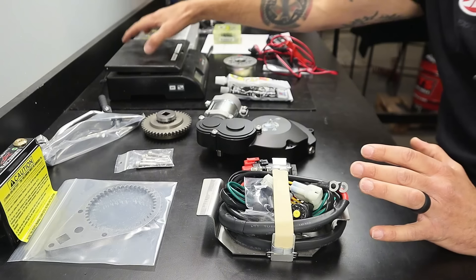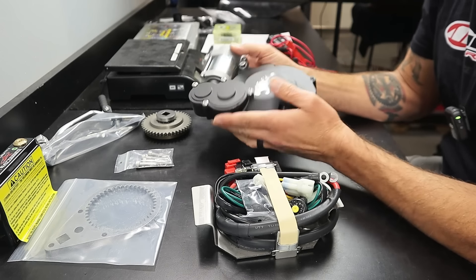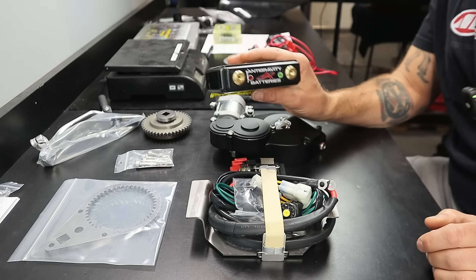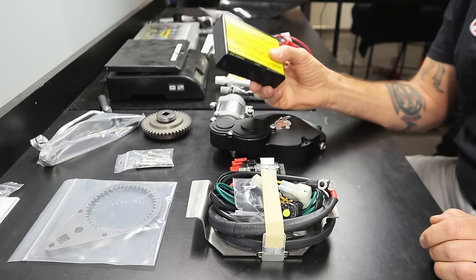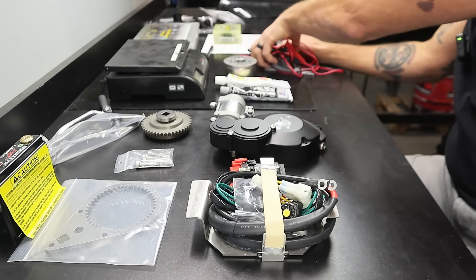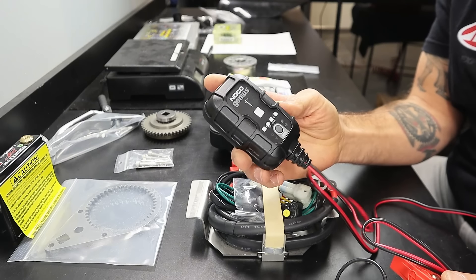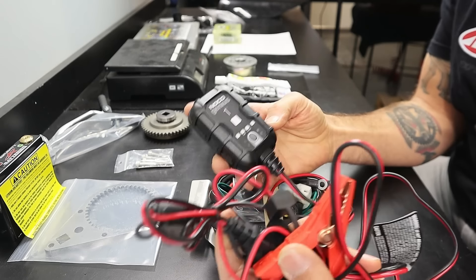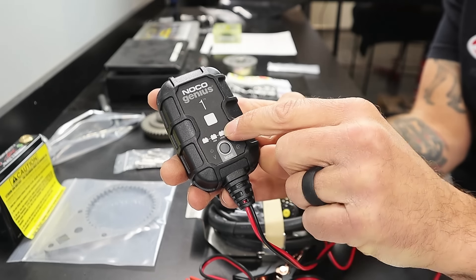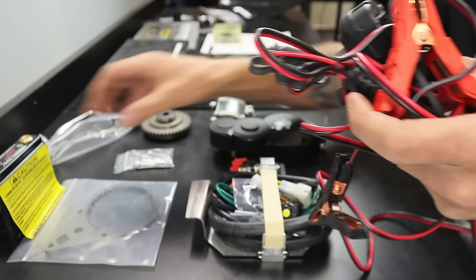Let's go ahead and get all these new components up on the scale, get a total weight, and I'll talk about why that's important and what it might mean for your suspension. In the meantime, we're going to get a charger on this battery — it's been in transport, who knows how long. When charging a lithium battery, it's very important not to use a standard lead-acid type charger — you'll ruin it. My buddy Kevin owns Ride More up in Canada and sent this charger our way; it actually switches automatically to whatever battery type you have.